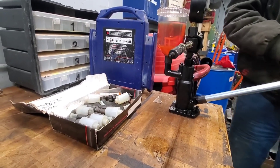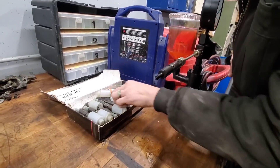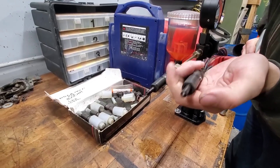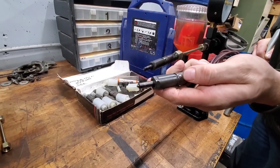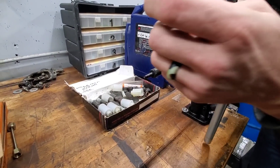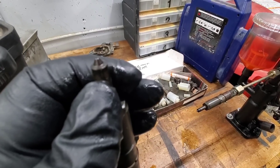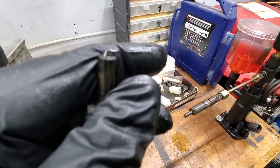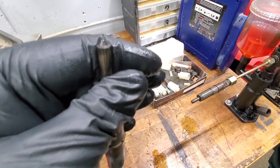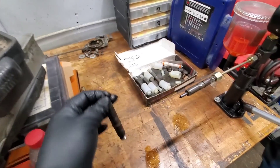We're gonna try it and see what it does. You want to make sure your spray pattern stays in the right shape and form that it's supposed to be, and you can look at the ends of the nozzles. They are in an odd shape because these 12-valve injectors are actually offset and designed to be one way. If you look at the little holes in the nozzle, you can see how it's in an oval shape — like an ellipse. You want to make sure the spray pattern is spraying in the right fashion and you don't have any nozzles that are messed up, but it won't look like a perfect circle.